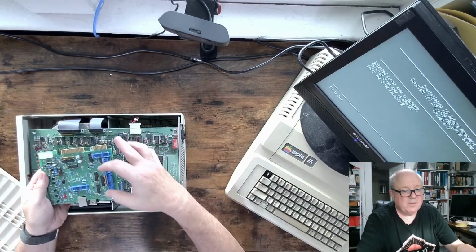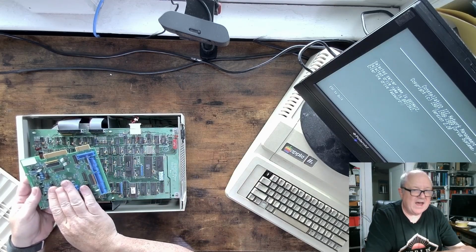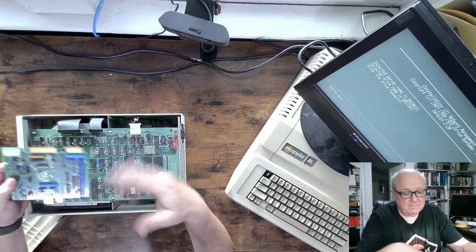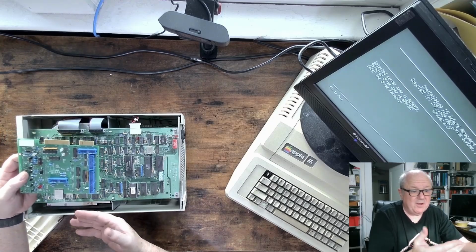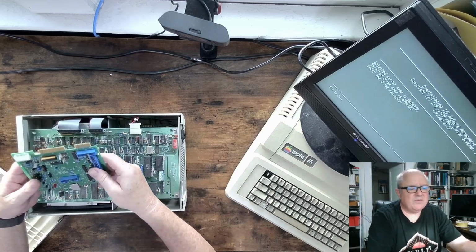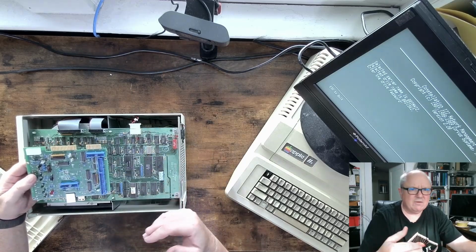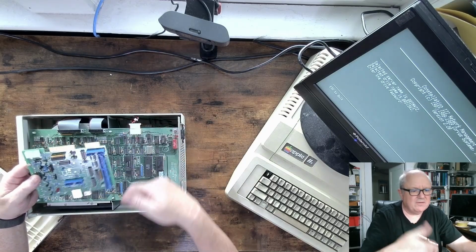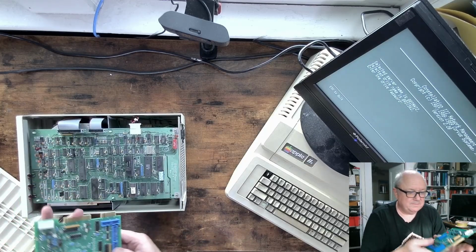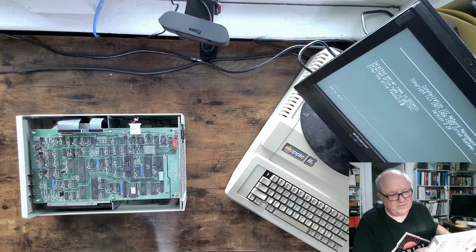The other thing, this unit can both read a drive and act as a drive. So that's been a lifesaver for a lot of people, like if they had an old PC, or if you had something like a Corvus, which is unique and uses MFM, you could read off your data before a drive died and then be able to emulate it. Where the DREM's advantage is that it emulates multiple different devices at the same time, both floppy and hard. And in fact, it also emulates unique floppy drives and some unique hard drive types. It will also emulate an RLL drive if you needed to do that. So that's where we are on the hardware side of things.